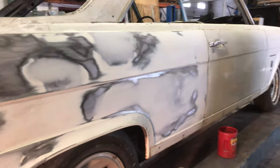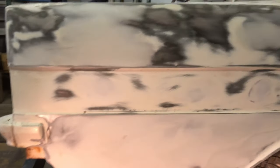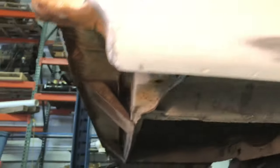This quarter panel's about done. I've just got to sand it off with 120 to smooth it out. This repair is done, there was one here and this big one right here. The inside was done too — just a small one inside there. Underneath you can see those holes that mimic spot welds, like the other side — little round spot welds. All the top's done, it's ready. Polyester.